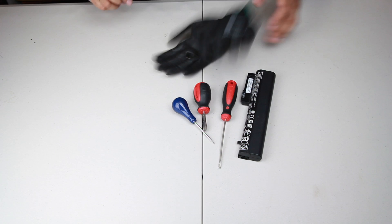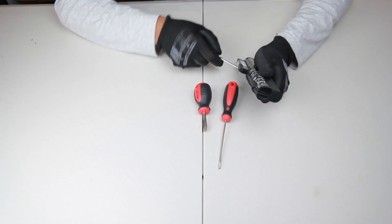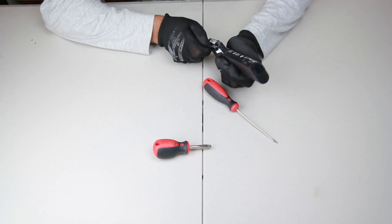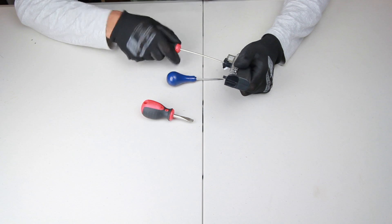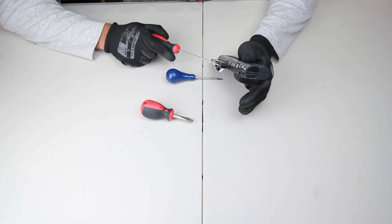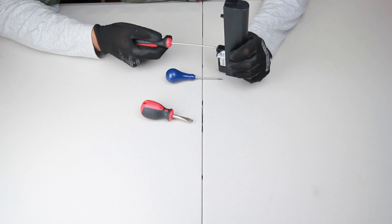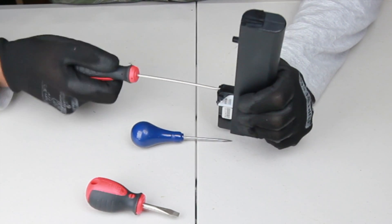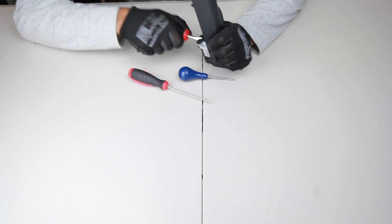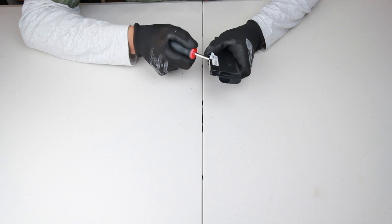Safety gloves first. You can see mine has been well used. If you put your spike in there, go below rather than above and try to open up the split line — that's all you're doing. Just twist it in there. The most dangerous thing is when you're pushing the screwdriver in, you could quite easily slip and stab yourself in the hand — and I've done that quite a few times. Just use a twisting action to pry it open. Once you've freed one area of the split line, you can work your way through the rest and it should start coming away.